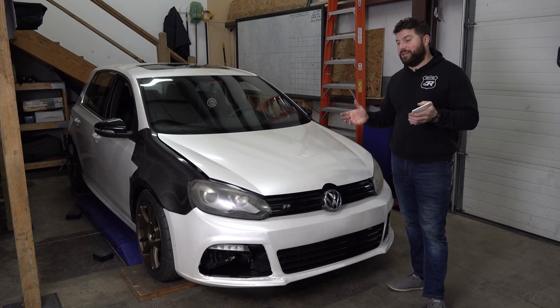Yeah, I don't want to do that too many times, but I just want to give you guys a taste of what's going on. This car is so fast, and it will make higher boost than that. In the low end, we were seeing low to mid 40s before I got out of it, just at the beginning, bam, get out of it, I don't want to bend a rod. So we definitely need to get that under control, and tomorrow my manual boost controller is supposed to show up, so we'll get that plumbed in and get that boost tamed down.